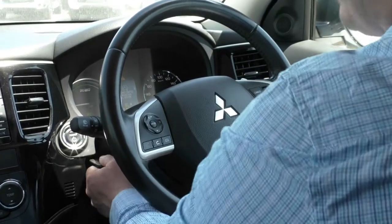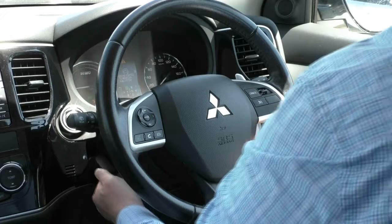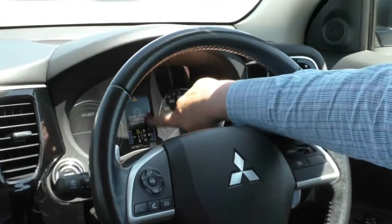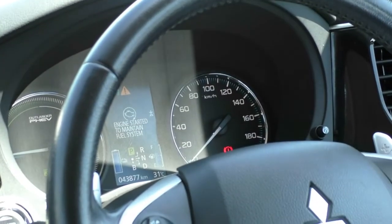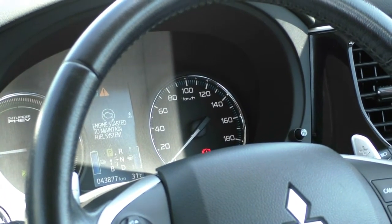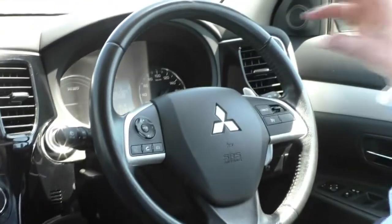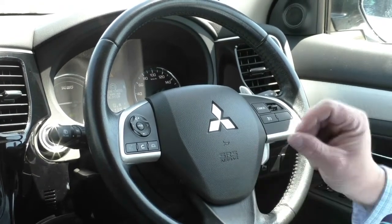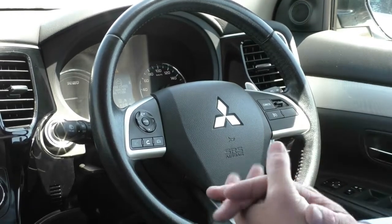While we're looking at the steering wheel, the great thing is with our lever on the side — it is telescopic as well as height adjustable, which is really good. You'll see here, we've had one of these come in and it's the first time I've seen it come up for quite a while: 'Engine started to maintain fuel system.' The great thing with these cars is they do have a 52-kilometre range on just battery. So if you're not driving big kilometres, a lot of people won't even use any fuel. After a certain amount of time, if the petrol engine hasn't run, the computer system will actually say it must run to lubricate the injectors, the fuel pump and everything, to make sure they stay working and your petrol engine actually starts when you need it.